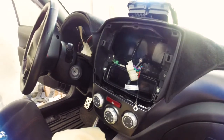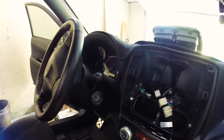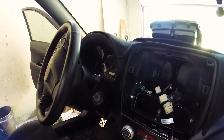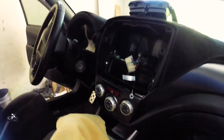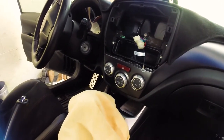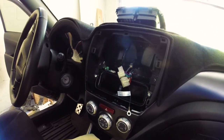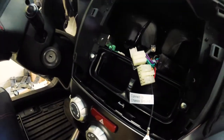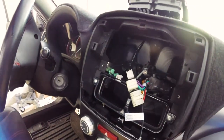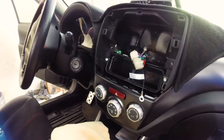All this work — the seat removal, everything — the amp goes up there but all these panel removals are just for the sub umbilical, they call it. From there you basically start removing your dash stuff: you've got to remove the radio. I'm going to move to the climate controls and remove the binnacle up there. Basically you're working the wire along — it's going to go behind the dash to the radio and then snake up under the hood. The nav radio has so many connections — six connectors and a ground bolt on the side of it.